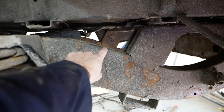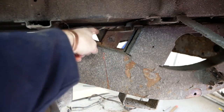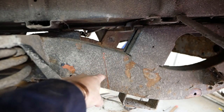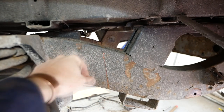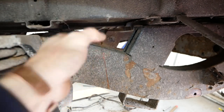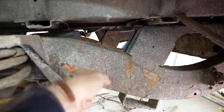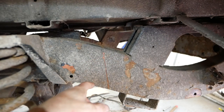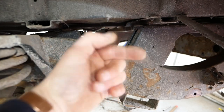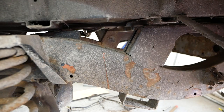First cut, I'm going to do the passenger side, all measured out the same as the other. So cut down there, cut across the top. Like I said before, there's no wiring loom in this side, so I can cut this one and then make a very gentle cut on the other side to make sure I don't chop the wiring loom. It's just a case of cutting in a little bit at a time. Cutting the top's fine, it's just where the long wiring loom sits at the bottom, because until you've cut it and pulled the chassis away, you can't push the wiring loom up the chassis. So right, grinder time.